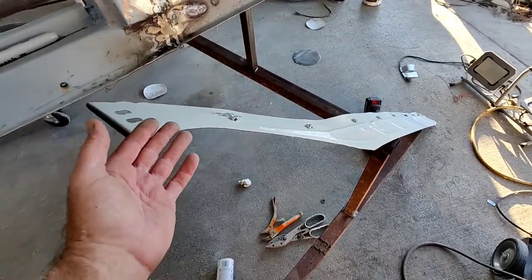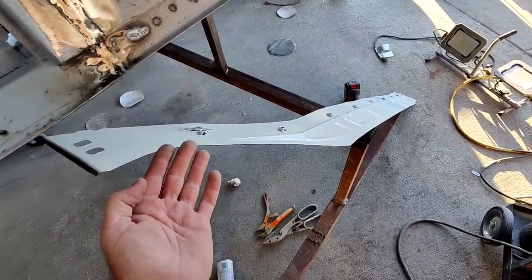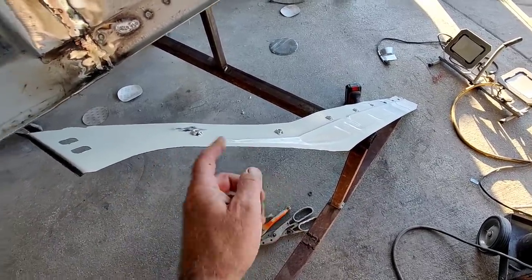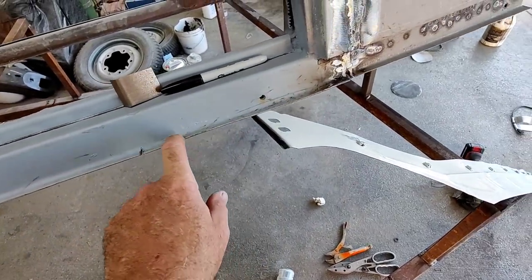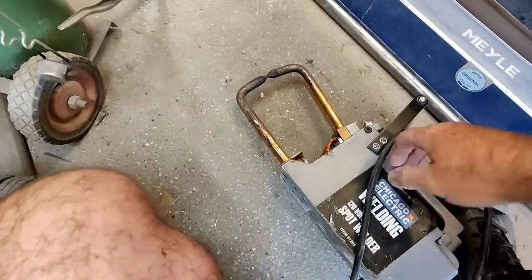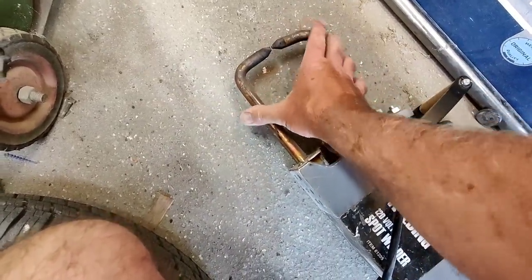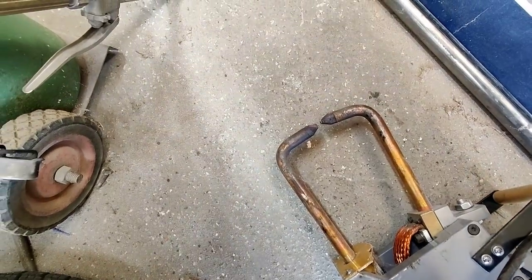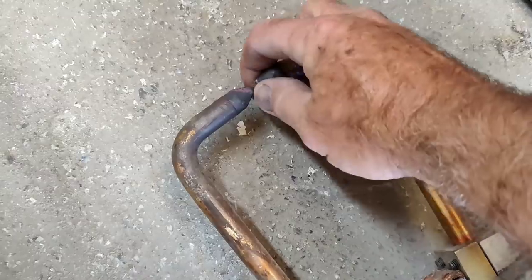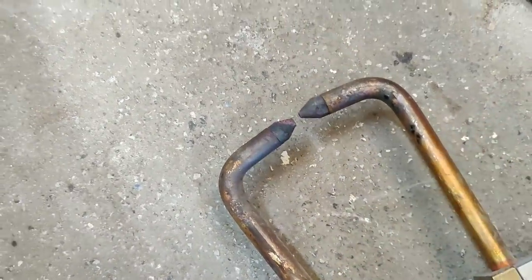So the next thing I'll do is weigh out, okay, I could grind this off and I could use my Harbor Freight pinch welder to put this on. I'd have to have this area clean, underneath here clean, and the top of this clean. All would have to be really nice and clean, and make sure that I pinch it really good, so that these things meet perfectly when they're shut. They need to be a really good, nice mating surface for that.